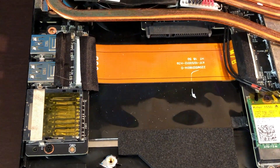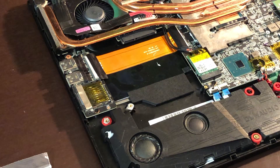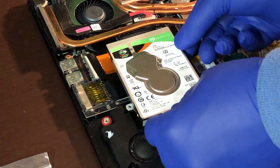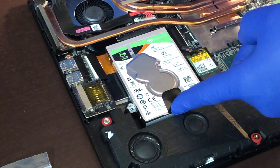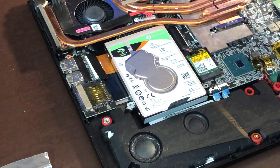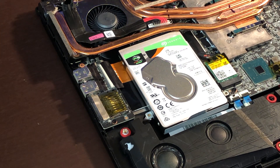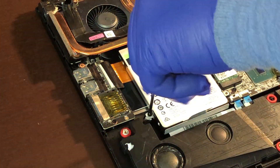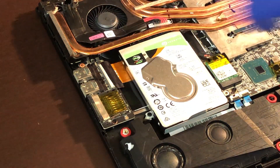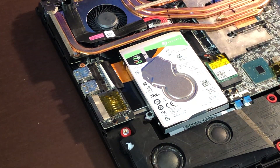This is the location where the install will take place. Take your drive and fit it directly into the slot — it will be a bit stiff. You can take your finger and help it along by pushing the back of the drive. It will not take a lot of force, so if you are pushing and your laptop is moving, then something is wrong. When it is installed correctly, the holes will line up. Grab the two black screws and start mounting the drive caddy to the case. Don't screw too tightly, just enough. It felt like the screws were going to strip the plastic mounts, so I just crisscrossed until just right.